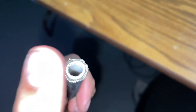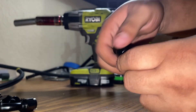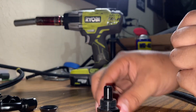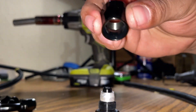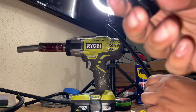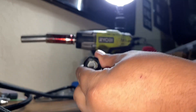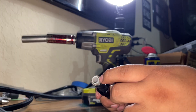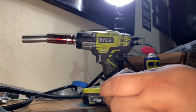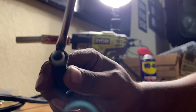To assemble the PTFE fitting, first disassemble it — you get three parts: the fitting itself, the flare nut, and the sleeve that goes over the PTFE line. First, flip that sleeve and slide it onto your hose. Next, get a flathead screwdriver and flare out the braid slightly. Just push the flathead outward all around the outside of the braiding — not too much, just a little.